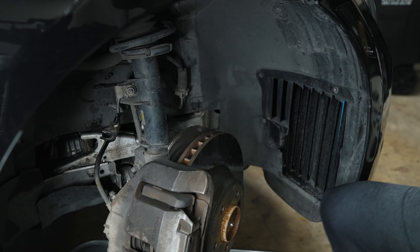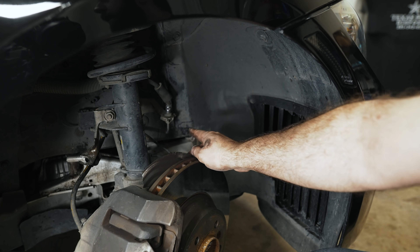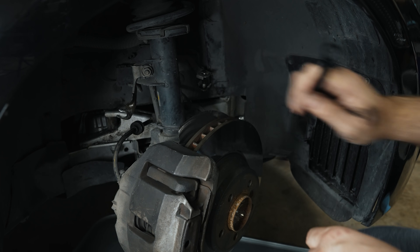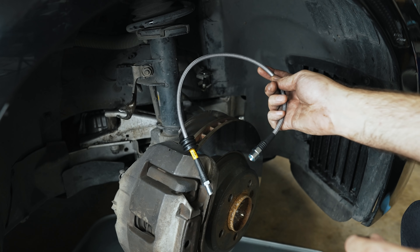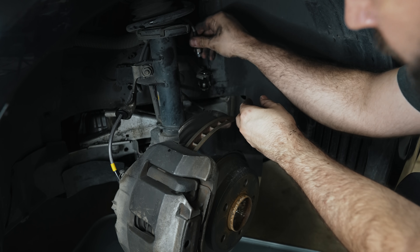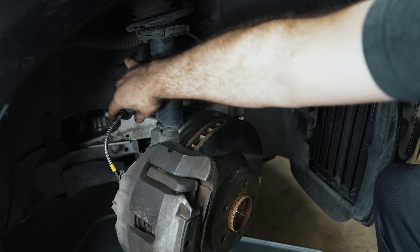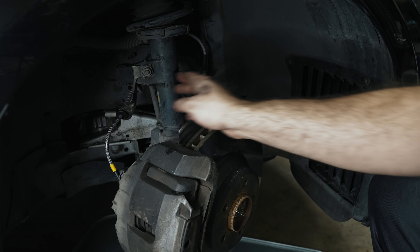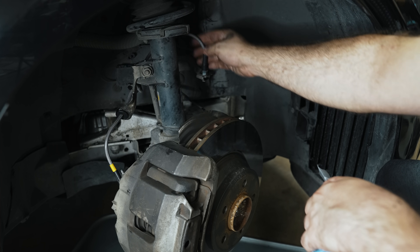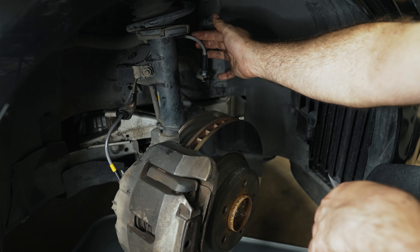Here's the brake line — use some silicone spray to help pop it out. The brake line popped out from both places; it just screws in over here. Use a line wrench to remove these — this is an 11 mm line wrench. Keep in mind the way I'm doing this will introduce air into the line; we expect that because we're going to do a thorough bleed after. You need just an open-end 14 mm on the caliper. Grab the new line and place it, using the washer that comes with the line. Up top is a 14 mm, down here is an 11 mm with your line wrench. The main thing to focus on is management — luckily this is a good kit with two rubber grommets that snap into the factory positions, with enough slack on either end so it won't bind up.